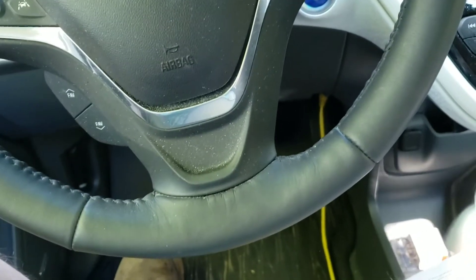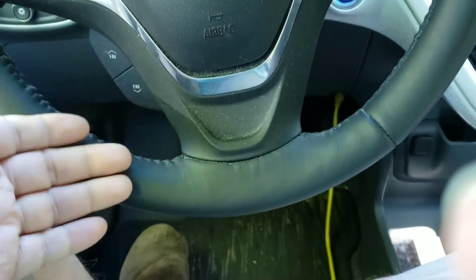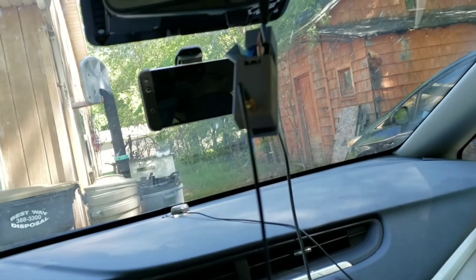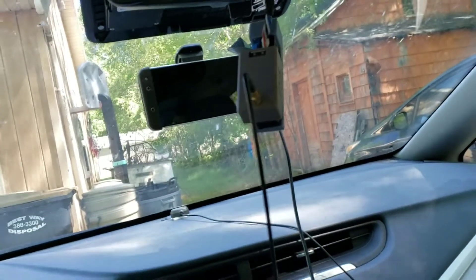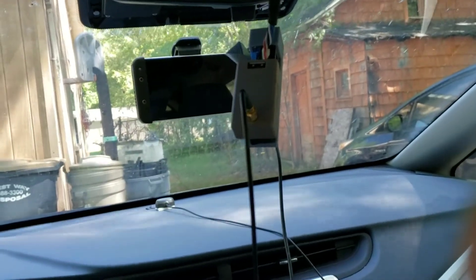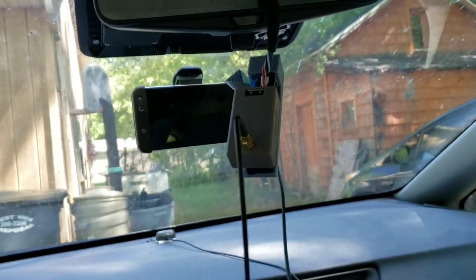The next step is to work on the pedal. I had this great idea — I thought the pedal communicates with openpilot using the powertrain bus. That's the main bus in the car, and really the only bus we need to use for this port. And the low speed GM LAN, but we're not going to have access to that starting out of the gate with the Comma 2 — all that does is the dash notifications, so not a big loss. You don't have to technically have the pedal plugged into the giraffe or the harness; you just need to get it on the powertrain bus somewhere.